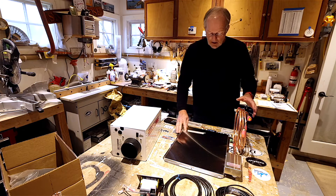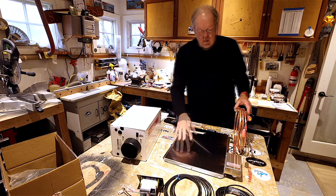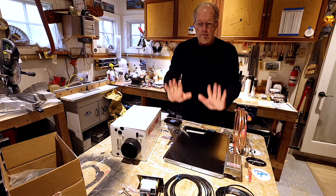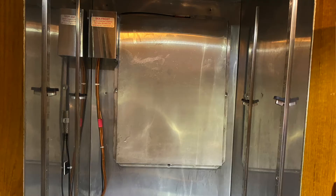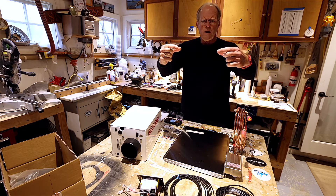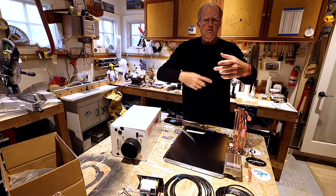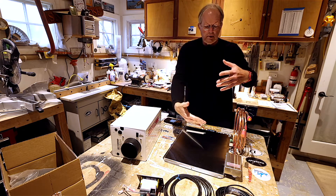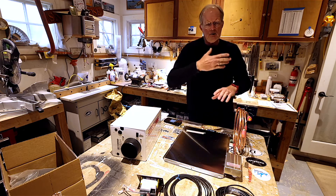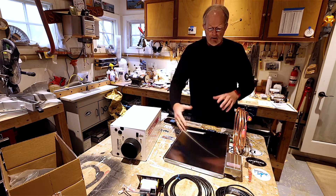You need to leave an inch and a half between the bulkhead and where the air comes out, and then it'll go straight out again in a different little louver in the door. Over here we have the evaporator plate, and this relies on thermal convection to work, which means we'll mount this up against the wall in the refrigerator vertically. That way, with thermal convection and the plate off the wall a little bit, you'll get air circulating — the cold air will drop down, cool all the food, warm up, come to the top of the box, and you get this really nice cycle going.